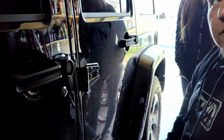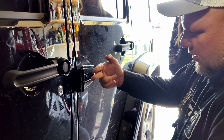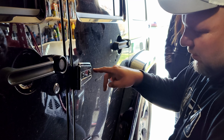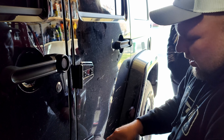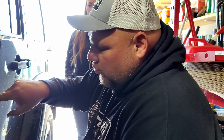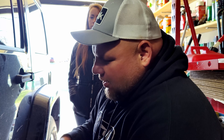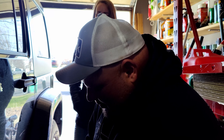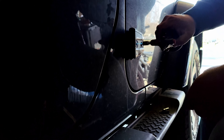How many can be loose before we have to start worrying about the alignment of the door? You can loosen all four. On the inside of the door is a plate — as soon as you take the bolt out, the plate drops. Right now it's stuck there, so don't back out too far so that plate moves at all. Just break the seal is what I'm doing right now — backing them out just enough to separate the paint seal. The tricky part is when the Loctite on the inside cools off enough and re-grabs, so when you go to twist it again with someone holding the door, it doesn't want to move and you have to do it all over again. You've got to find the sweet spot between taking it out enough that it doesn't re-adhere and so much that the plate drops. Having done this a few times really helps.